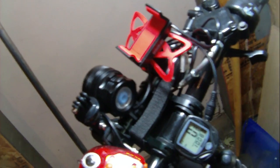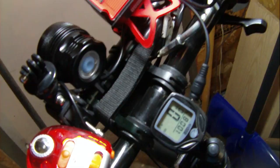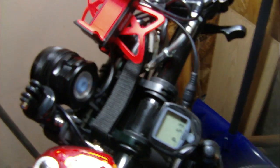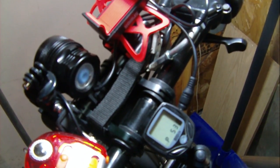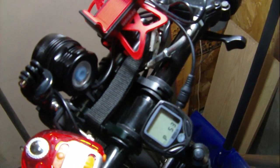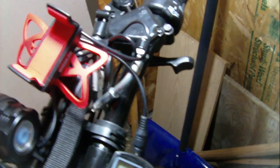This thing was flopping all around — the headlight and everything was just flopping all over the place making me mad. I tried using Loctite thread locker but it actually acted like a lubricant because it doesn't work well with rubber. So I used Loctite super glue instead and now it's stuck. I've got multiple layers of rubber shims — the rubber that came with the rear rack kit — glued to the rail between each shim, and now it's pretty solid.